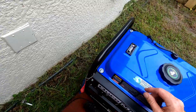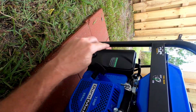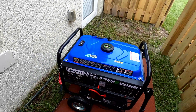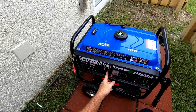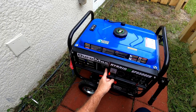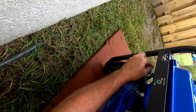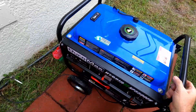There's also a choke over here. I'm going to turn on the choke — we only choke it to start it. I'm in a warm climate in Florida so we don't even have to leave the choke on very long. Put it to run, then the next position up is start, and it should fire right up.